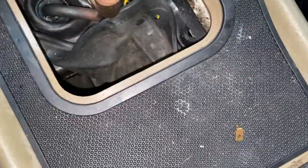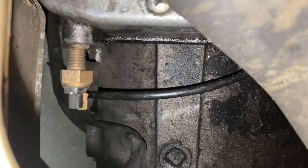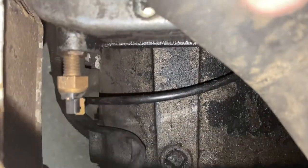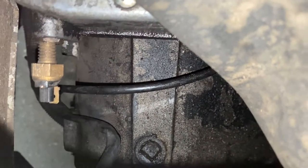You can see I got the boot lever moved out of the transmission. As I said before, my reverse lights don't work, and that's because of that little thing right here. You'll notice it's missing an L-bracket for the cables to hook up to. One of the reasons being that it's sitting right here — it broke off. So I need to solder that back on before I can actually hook it back up. But the reverse lights were not turning off.